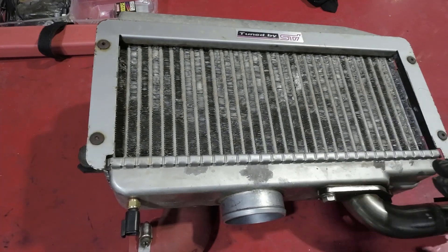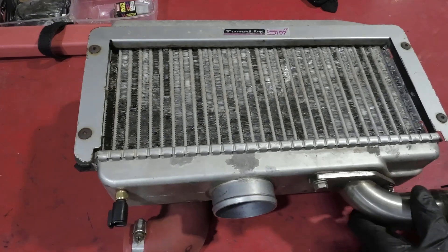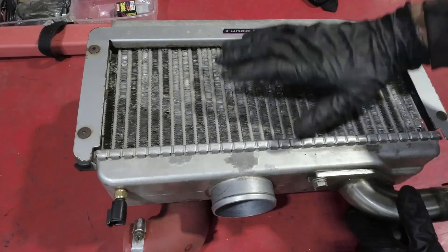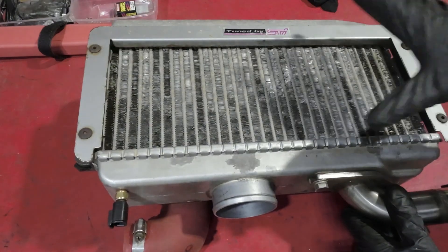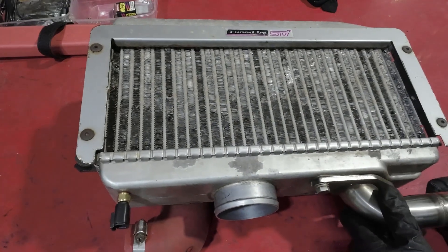We are interested in the intercooler because all the time the car is moving — particularly on colder, wetter rallies — water moisture in the air is rushing through the intercooler as the car moves. That air is passing over and down through the fins, helping to cool the air down. The intercooler, in terms of its shape and size, works relatively efficiently for what it is. However...